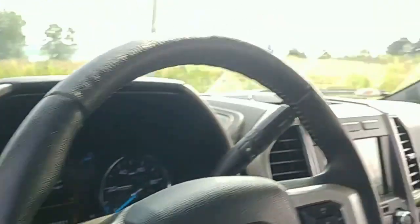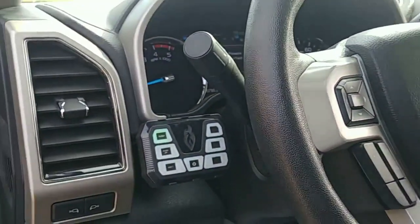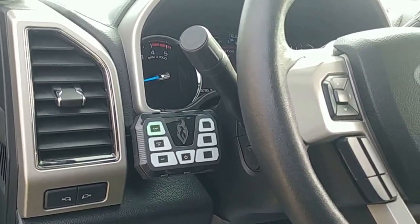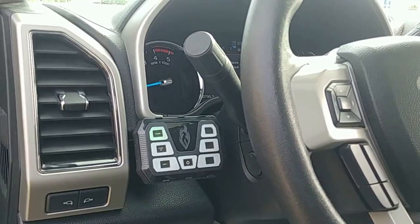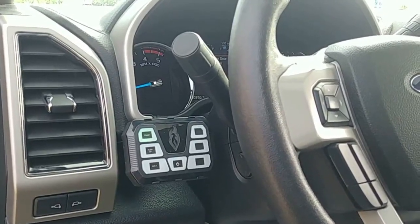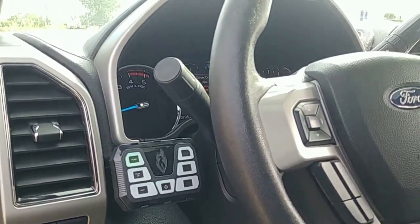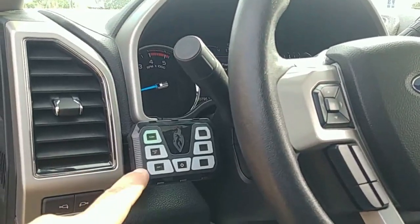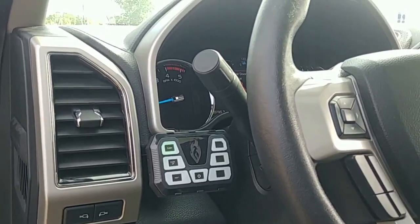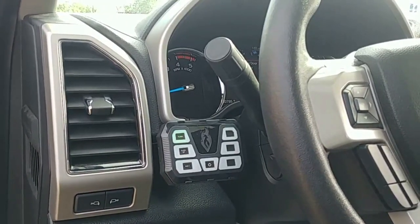So that's how we did this one. No switches in this one and the budget didn't allow for adding those, so we went ahead with the Mini 6 switch because it's a lot more budget-friendly. In the rear, it's simply two sets of our hideaways. We're going to give you 50 feet of 18-5 — that's 25 feet for each set of hideaways — to extend the hideaways up to the switch. So you've got your hideaways, your wiring for the hideaways, your Razers in the grille, your wiring for that, your mirror kit and wiring, as well as your Mini 6 and wiring. Everything will be bundled up and ready to go.